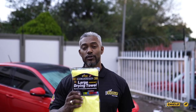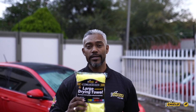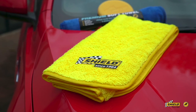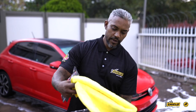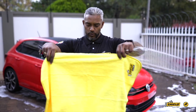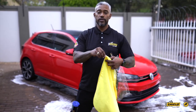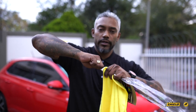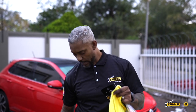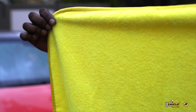We're done with the snow foam shampoo. You can see the car is now sprayed off and clean — it's ready to get dried. Your go-to is our large drying towel. This super-size towel comes in a plastic sleeve, and as you open it up you'll see it can cover quite a large surface. First thing: remove the label, because that will damage your paint. You'll see two surfaces — one thicker, the other with fibers that actually collect the water from the surface.